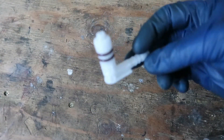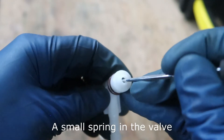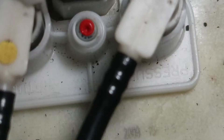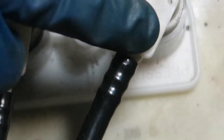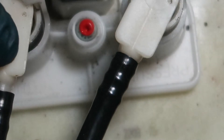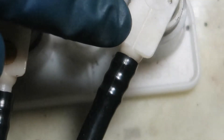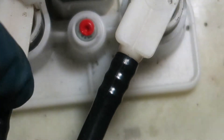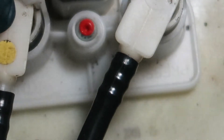This is a no-pump check valve — hopefully this will hold pressure when the pump is off. This is the pressure side of the fuel pump and this one is the return line. According to what I've read online, this should have a check valve in it where the fuel can only go this way and should not be able to come back. This one should be open and the fuel should be allowed to flow through.